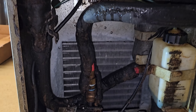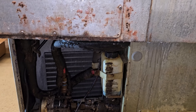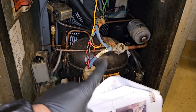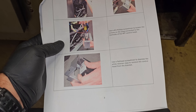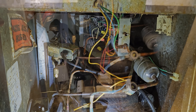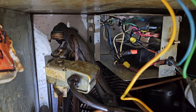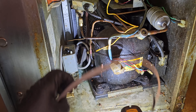We've got this all disconnected in the back. The condenser — since I'm back here I can see through it, which is a good sign. Now we're going to go to the front and start doing some work up there. Moving through the steps, it says to remove the front display, unplug everything, get everything disconnected, and get the controller pulled out. There are specific instructions for removing the factory pressure control, but this one no longer has one, so I just cut the wires.